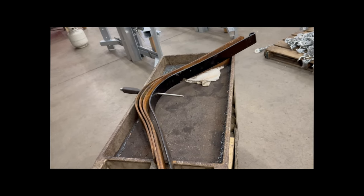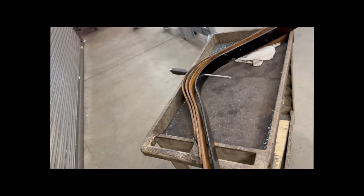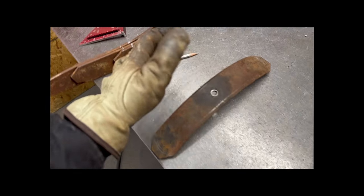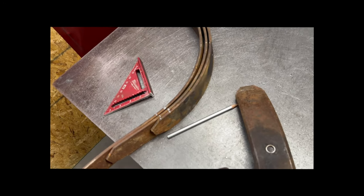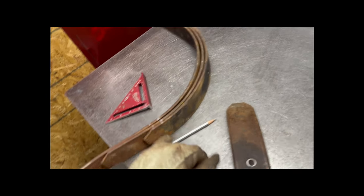Shoutout to Millworks — I don't know those guys personally but their customer service, shipping, and Instagram have all been really solid. Here's the leaf spring I got from them — already painted but it's going to need some love and still needs to be lubed up. It was an eight-leaf pack, which based on my limited research I believe would be a roadster spring. I'm going to keep the new Millworks main plus the three next in line, trim this down and chamfer it, and do the same with the others.